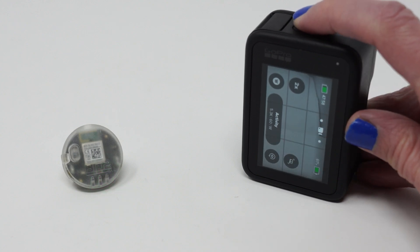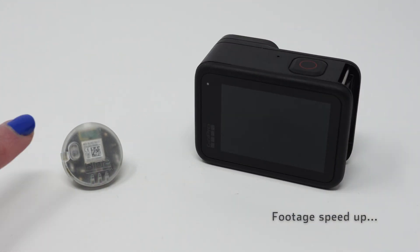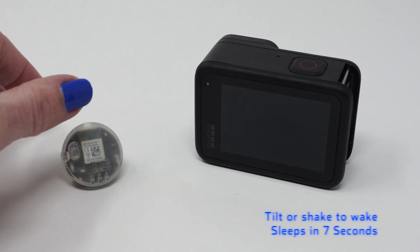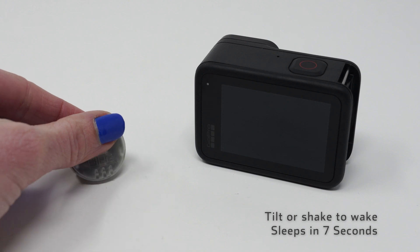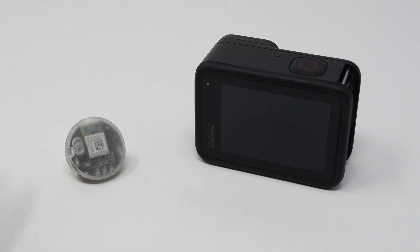I'm going to turn off the camera and show what happens when the Bluetooth light sleeps. When the camera is not turned on and the unit is motionless, the Bluetooth light will go to sleep after several seconds. If we shake or tilt the Bluetooth light, we'll see the blue connection LED blinking, which means it's searching for the paired camera. This times out after several seconds.